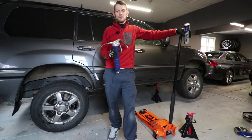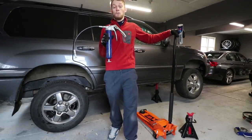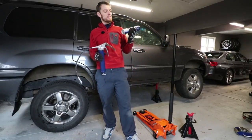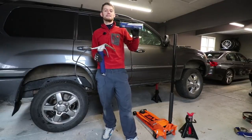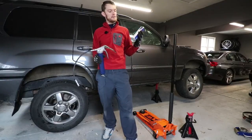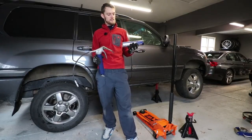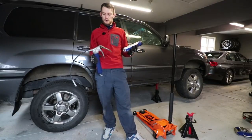I'm jacking this car up. Before we get too ahead of ourselves, I want to cover what you're going to need to do this. You're going to need grease to grease your drive shaft. Toyota recommends NLGI No. 2 grease — this is lithium grease. I got Valvoline SynPower; it's got moly in it so it's supposed to be better for impact-type stuff, which makes it a good application. Just buy yourself some quality grease from the local auto parts store.